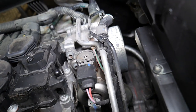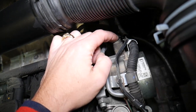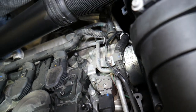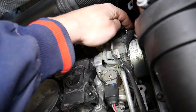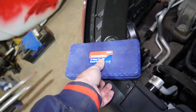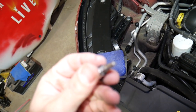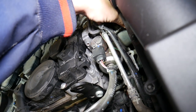In order to remove the pump, you will need to disconnect a screw right here, disconnect that line, and disconnect these lines. Another thing you will need to do is remove — I think it's three or four bolts with Torx bits. They're located right here: one, two, and two on the bottom. Let me show you what Torx looks like so you know what to expect. It's a bit that looks like that — this is Torx — and I think those are Torx 30.